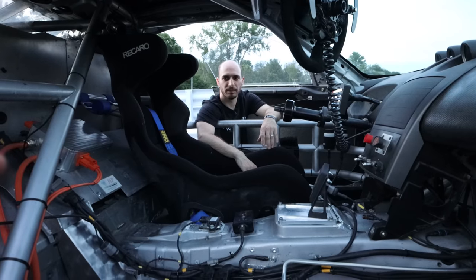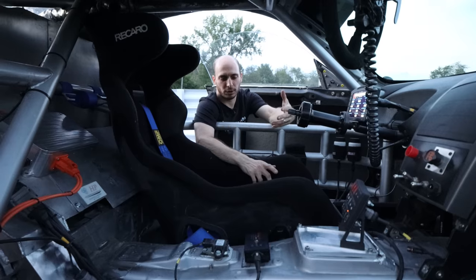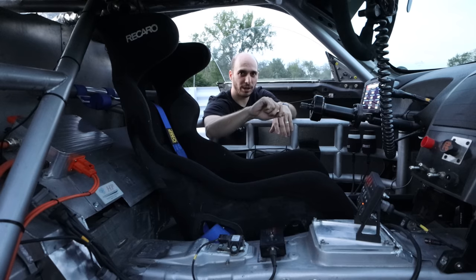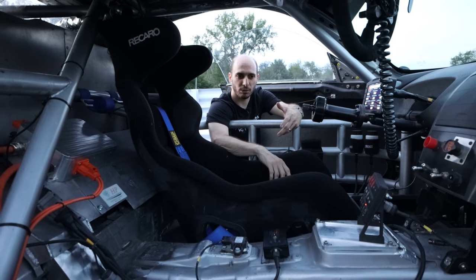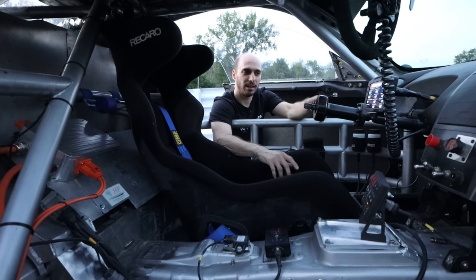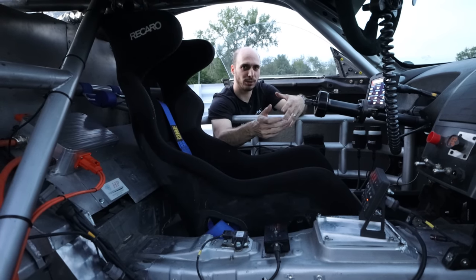So does this mean you have to charge it before every run? No, so the way that this system works, basically, the system is called KERS because it does recover energy. So whenever you're braking, it's recovering energy. Cornering, I can adjust on the dial how much, so it also affects the balance of the car. And then also when you're at partial throttle, you know, a gasoline engine is very inefficient at 5% throttle. So in those cases, the ECU is tuned, it has a torque request system. So I'm not commanding a throttle position, I'm commanding a torque.